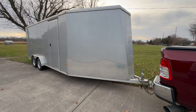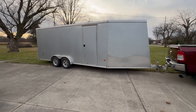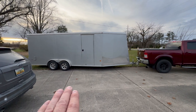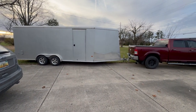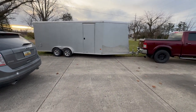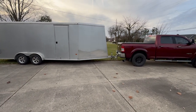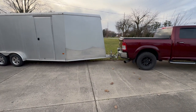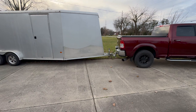It tows pretty well overall. There are trade-offs on everything. The axles sit pretty far back, which puts more weight on the tongue — but I don't think it's enough. This trailer unloaded does not tow great. I've found I need at least 750 pounds of tongue weight for it not to be squirrely on the road.